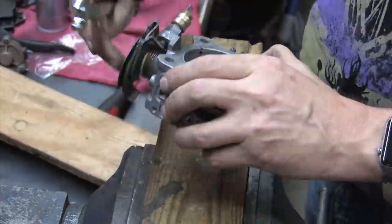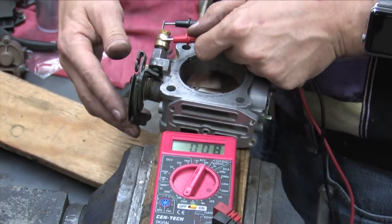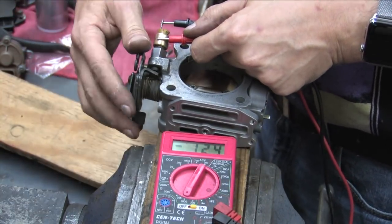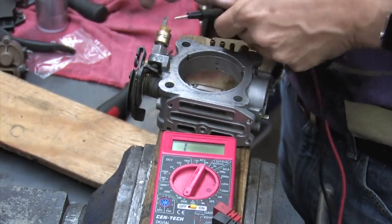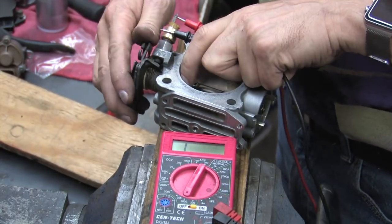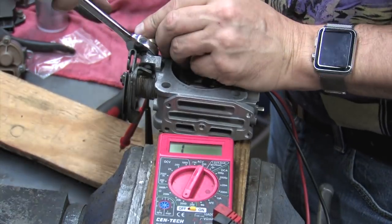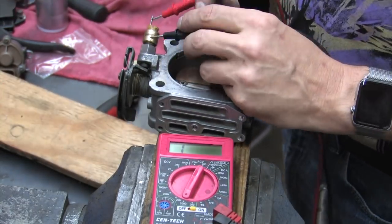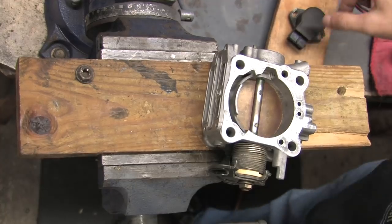If you want to check to see if it works, set up your meter and test resistance on any scale, and test for continuity across the electrical connector to the metal body of the switch. It's a momentary ground switch, so if it works, the switch should have continuity when the throttle plate is closed and when it's installed properly. If it doesn't, then it's bad. Replace it. Or if you have ECM link, just check the box to simulate it based off of your TPS signal.